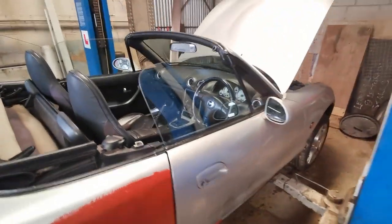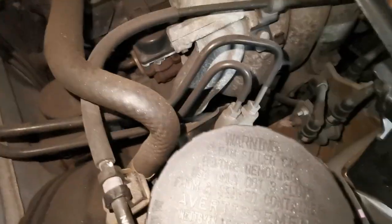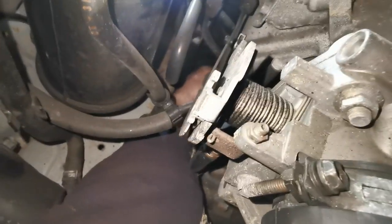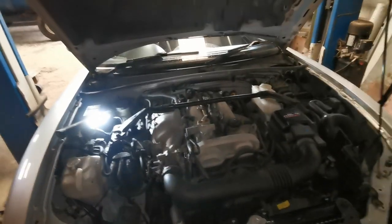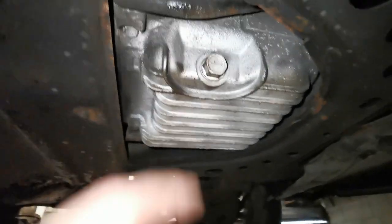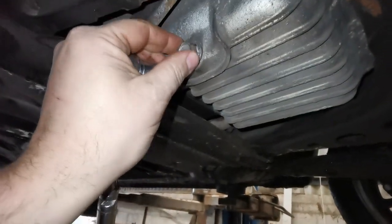That's long enough - let's get her up and get that oil out. Looking for the oil filter which is supposed to be down there somewhere but I can't see it. Oh yeah, right in there. Can we get to that? Reckon so, need smaller hands. It's going to be all coming from the front. Oh yeah, easy - we'll do that from the top then, don't have to take the under tray off. Right, somewhere under here, got the sump plug - let's find something that fits that and a container. 17 mil that is.